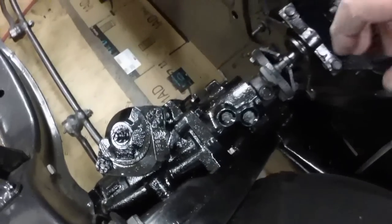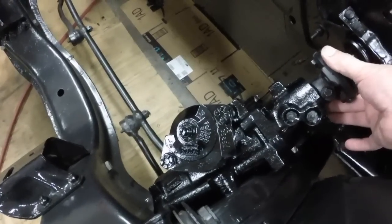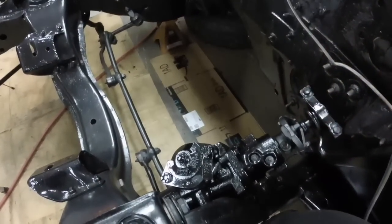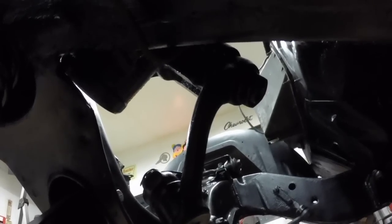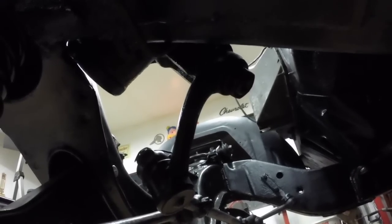The steering gear is 100% installed. Just moving the wheel just that little bit, I can see the steering linkage moving — so that's really nice that it's not sloppy. Let me show you the underside too. The pitman arm nut spec is 150 to 210 foot-pounds, and my torque wrench only went up to 150 foot-pounds, so I torqued it to 150 then put a little extra on it. It's over 150 foot-pounds. The front suspension and steering are all together.